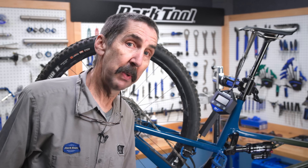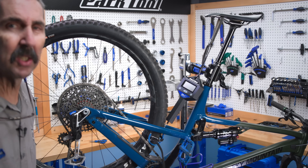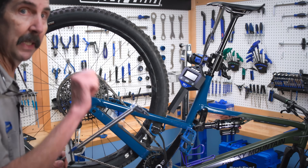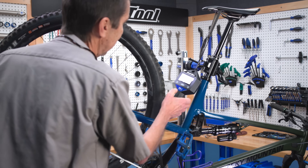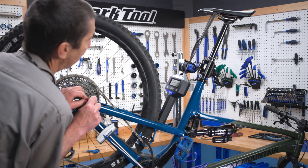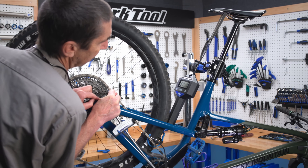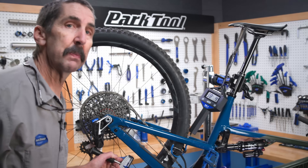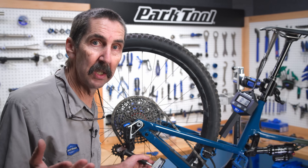Let's try an empirical experiment. We've installed the DS2 digital scale, getting it tangent to the wheel to simulate being on the ground when we ride. We're going to simulate pedaling with the beam scale here into the bolt. Let it zero, then pull up — 25, 32, 37, 38-ish. About 40 newton meters. That's pretty much what we would expect. Numbers are good, and your feelings are good too. Good to have both.